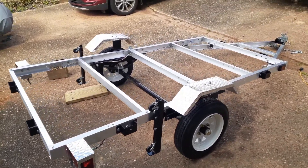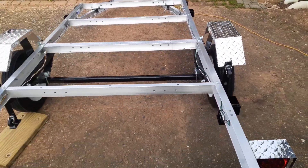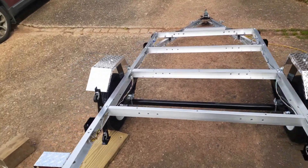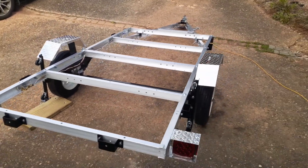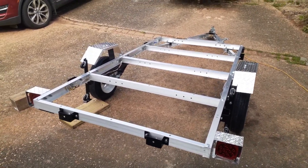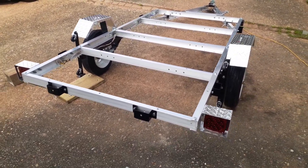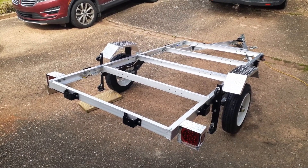I think it's worth it. The negatives are the overall cheapiness on some of the parts, and that it's not 100% square — looking down the rails I can see a little bit of a slant. They don't give you any guidance on how to true it up, and the tolerances aren't self-jigging, so it doesn't automatically go straight when you bolt it together. Some of the instructions are a little vague. But otherwise I'm happy with it — I'll tow a few things with it, put a wood top on it, and call it good. Thanks for watching Appalachian Dual Sport.